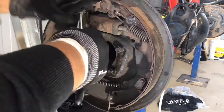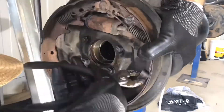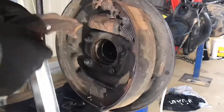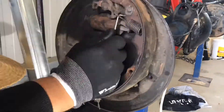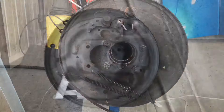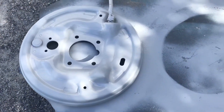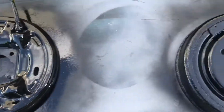Let's get stuck right into it by continuing to strip down the Holden 10-bolt diff. With all parts stripped, primed and painted, I've started ordering parts to rebuild the diff, including a mini spool to make it LSD.